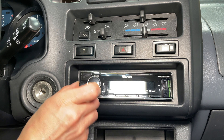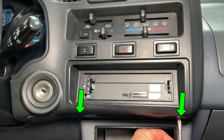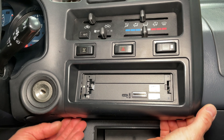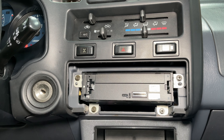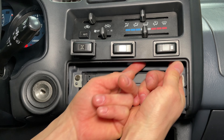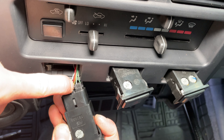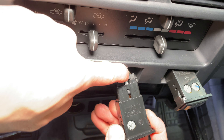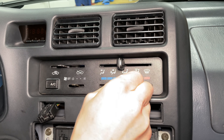Remove the radio faceplate first. Take out two Phillips head screws under the radio trim bezel. Loosen the plastic dash trim by pulling it toward you, then the radio trim will go straight down. Put your fingers behind the center locking differential, hazard, and defroster switches to push them out. Unplug the three switches and set them down in the same order on the passenger side floor mat. Pull off all four climate control knobs.